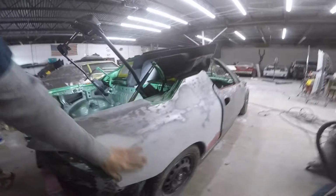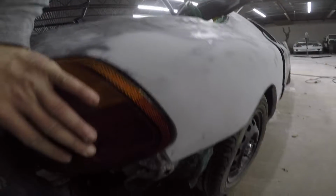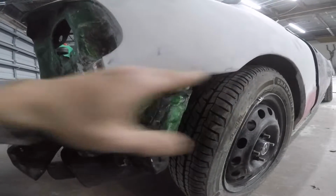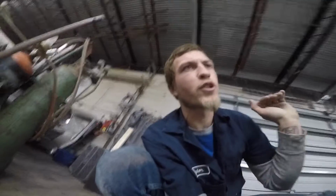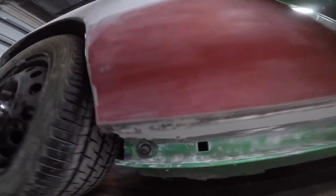I've got this quarter right where I want it. The taillight fits really nice. I can slap it in real quick, give you guys a quick little look. Boom. So our taillight fits really nice in the pocket there, all the way around, nice gappage. And then I went ahead and test fit the back bumper to all this as well, and it fits really, really nice. Went ahead, made this bend. This is all nice and smooth. Got this all flattened and squared out, so the bumper should lay really nice up to this quarter panel. No problems there. Went ahead, got all of my area cleaned up.